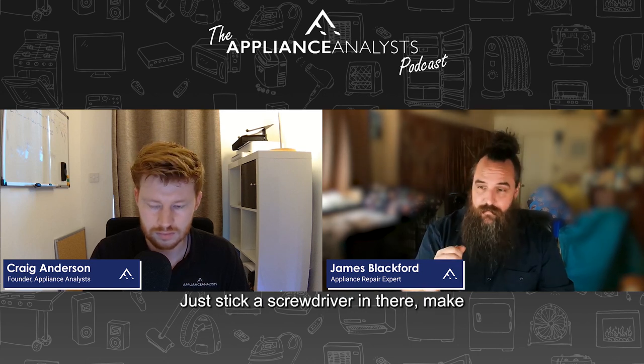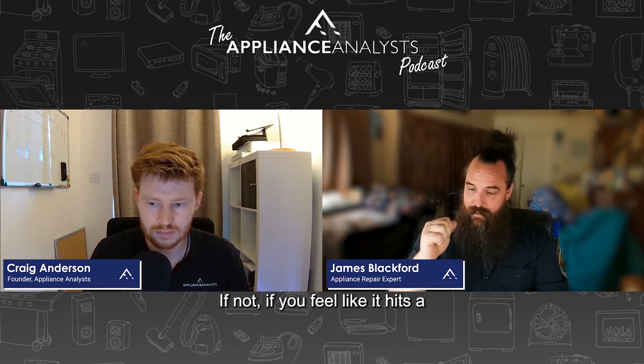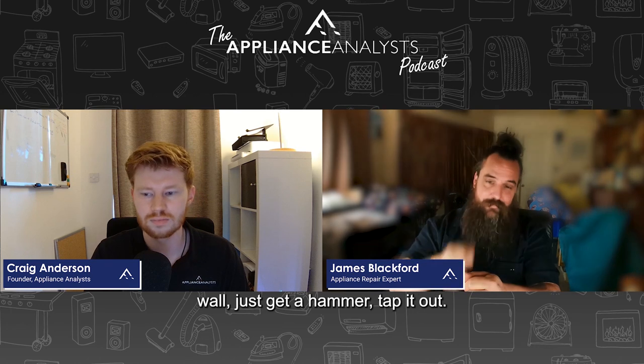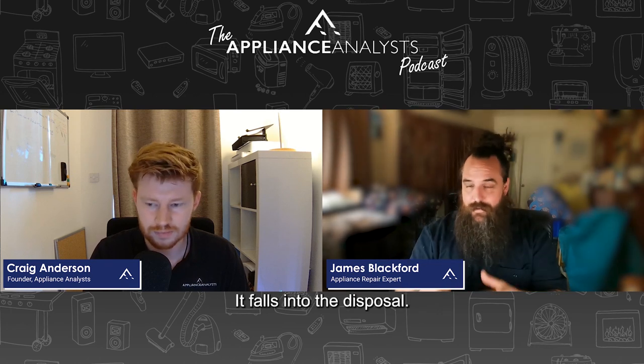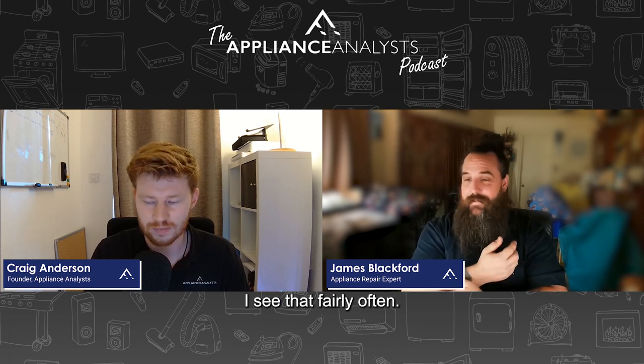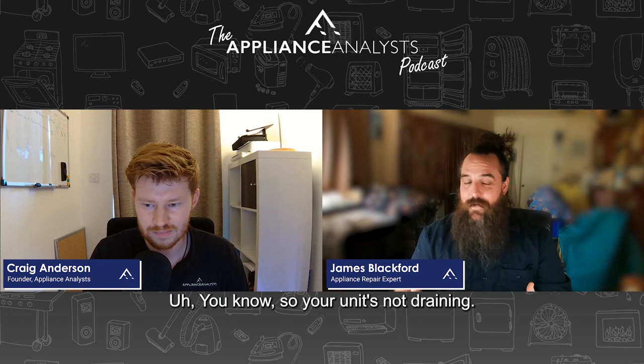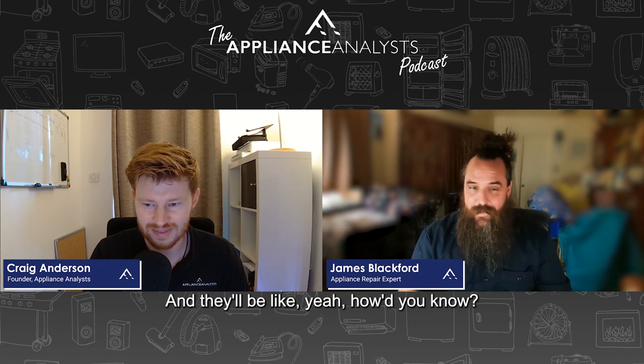Just stick a screwdriver in there, make sure it can go all the way through. If not, if you feel like it hits a wall, just get a hammer, tap it out. It falls into the disposal, that's fine. Hook the drain line up, it's good to go. I see that fairly often. It's pretty surprising. I'll ask them, you know, so your unit's not draining. Did you recently get a garbage disposal? And they'll be like, yeah, how'd you know?